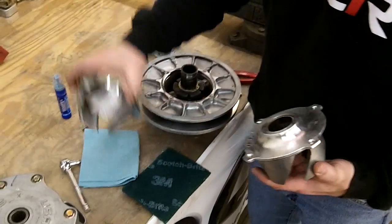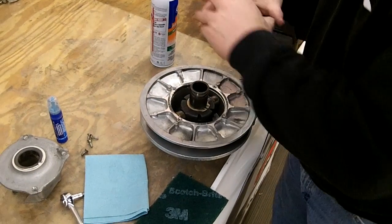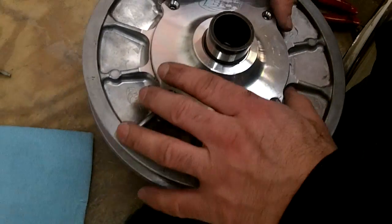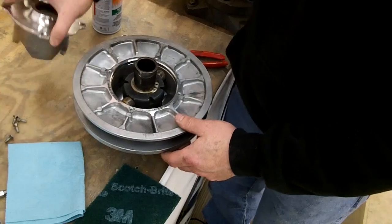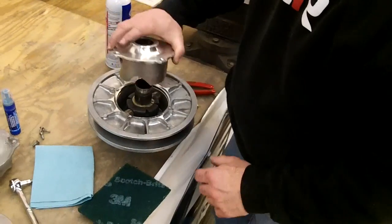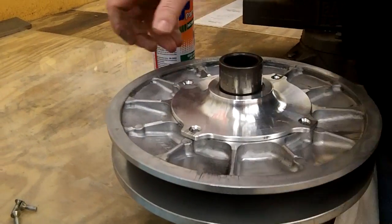So what you want to do is, depending on which Helix you go to, sometimes you might drop right in. Other times you might have to move them around a little bit to get the holes to line up. And basically you just line up this with the rollers, put it down in there. And this one actually happens to go right in, but sometimes you might be half a hole off, or half a turn off or something. So sometimes you just pick it up and turn it a little bit, you might be all right. Otherwise, if you got a screwdriver, just kind of pry down in there, but make sure you're going square on this plastic roller so you don't damage that, and turn it one direction or other, just enough to get it on. And then once we do that, it should seat fully down. Like there's a little bit of gap there. Once you get everything seated close, it should kind of pop down into place like that.